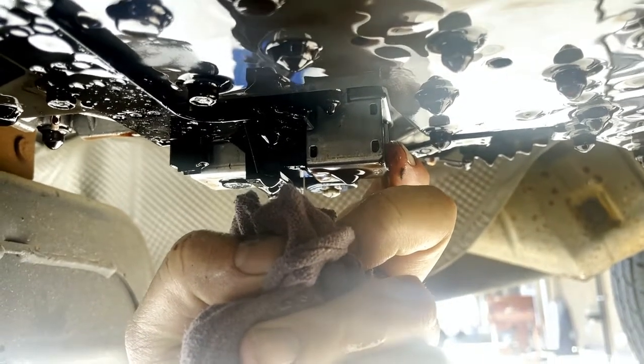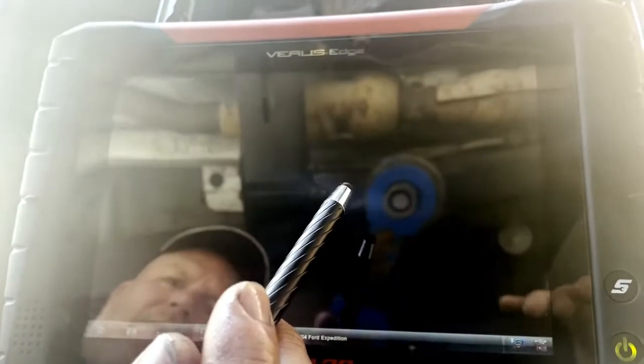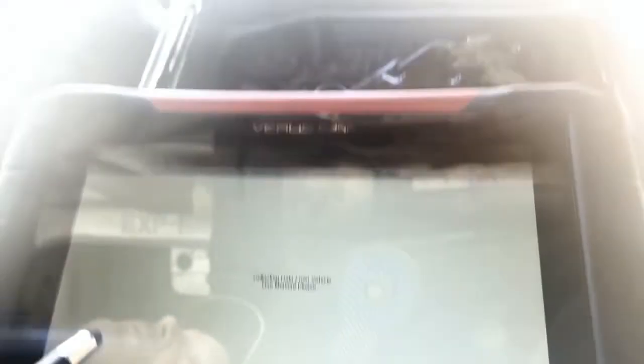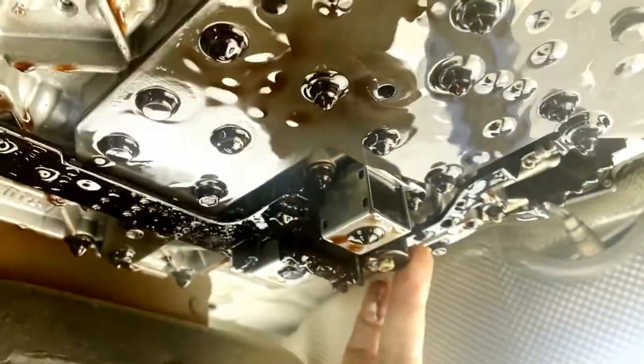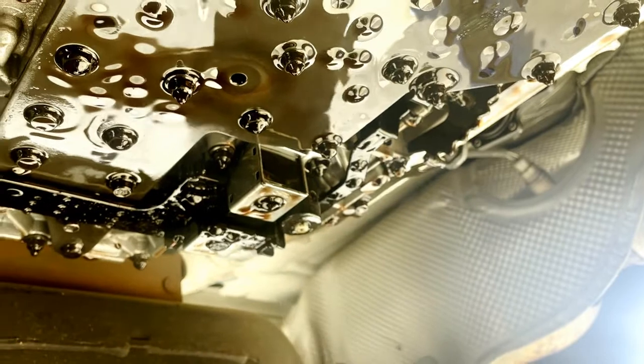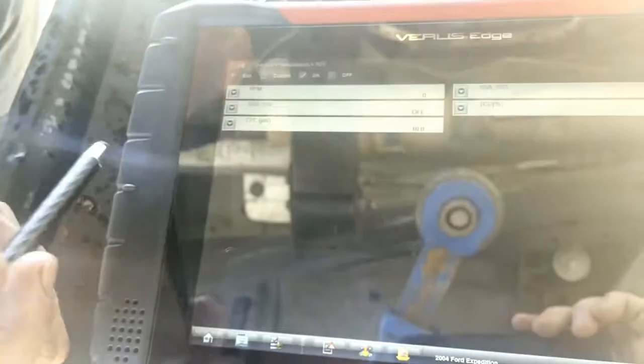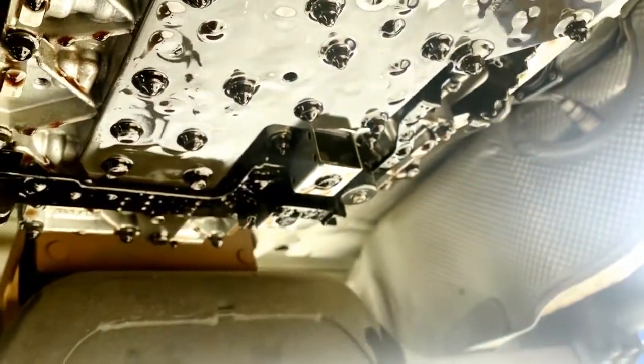Going to put my hand on solenoid one — on, there we go, off. Do it one more time — yep, that one's working. Now let's go ahead and do our TCC solenoid, which is the one right next to it. Man, it's hot! So these things are energizing — going off, then on. I can't even put my finger on it, it's burning hot. I can hear the click but I'm not happy — that thing is getting burning hot. The shift solenoids did not get hot; this one I can't even touch.